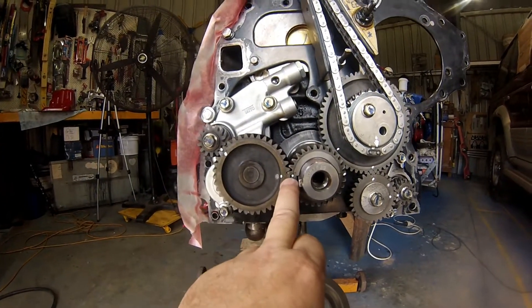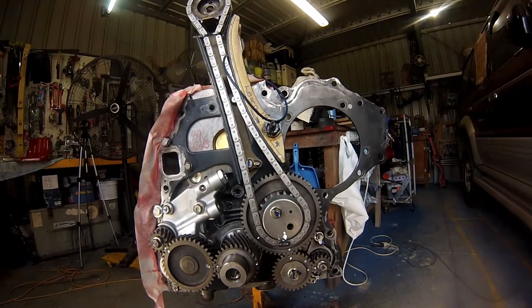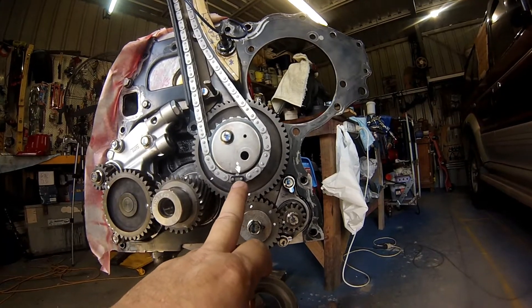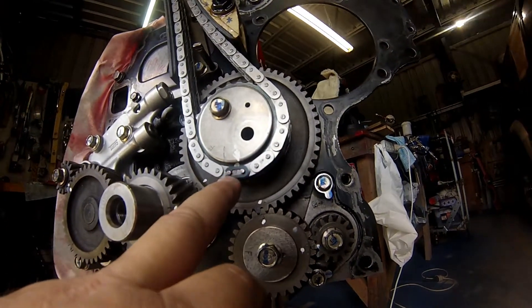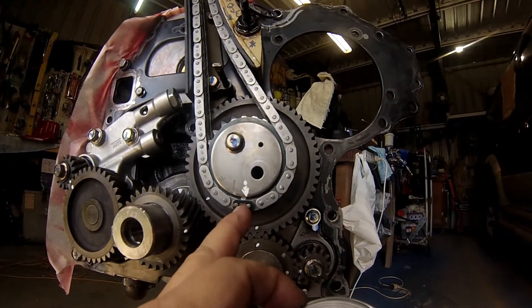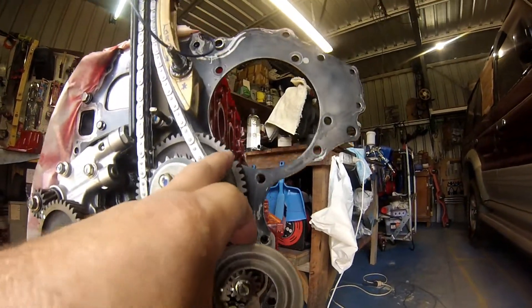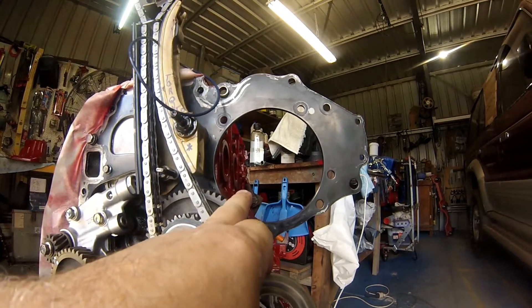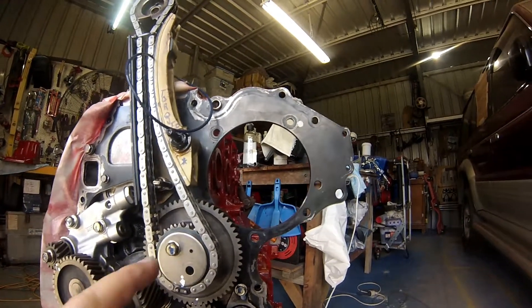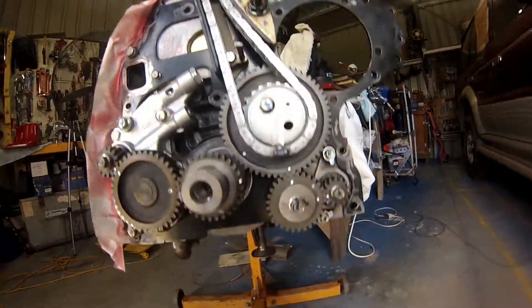There are little white dots and punch marks in there with numbers. This one here - there's a mark where I've got that white dot, I've gone and covered over it, but there's a little dot there so that's where that halfway link joins up. Then with the injection pump, there's a T and an N on the back with a groove. This is a turbo model, so you line up the T with the groove for the turbo model. That's where we're up to.